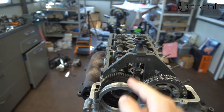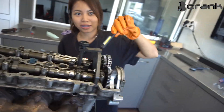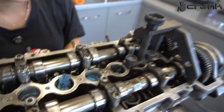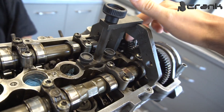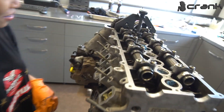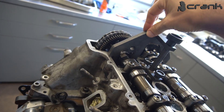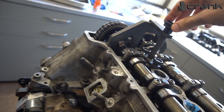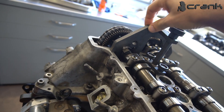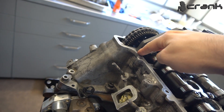That's how you know they are installed correctly to each other. We have installed this tool here to time the camshafts correctly in their position — to time them to each other, but also to time both camshafts correctly to the crankshaft. There is a square here on which we put this tool, holding everything so it's not moving, making sure the alignment is even.